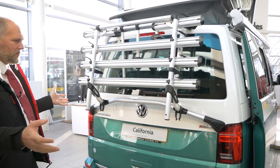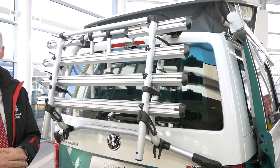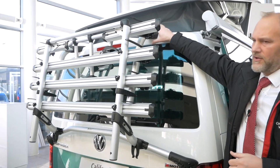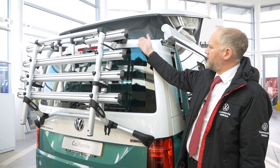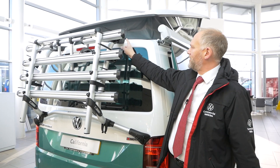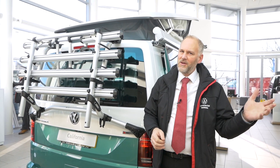As you can see, the bike rack is on the back of the vehicle. It's very easy the way in which it goes on. It is designed to be kept on the vehicle — you can take it on and off but it's not as easy as it sounds. Essentially it lips over the top bar. Obviously you can't have a spoiler on the vehicle if you're having the bike rack on. I have seen one person who cut a hole in the spoiler on the back of a vehicle to actually get it in, but generally speaking you have a spoiler or you have a bike rack.